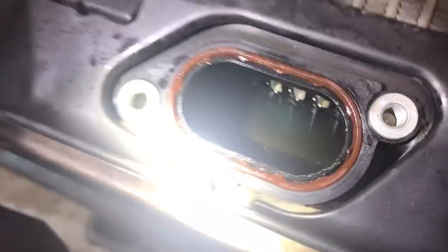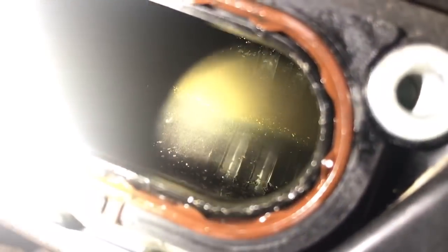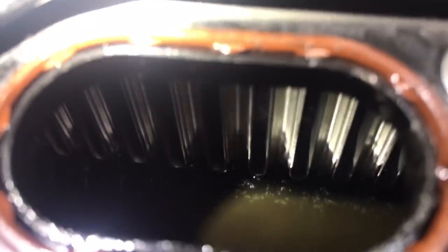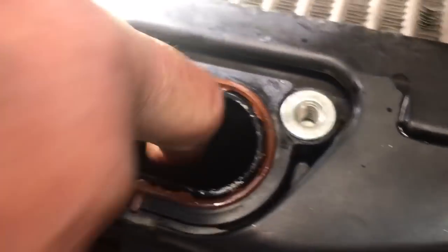I won't drain it on the bench, but that's what we're cleaning inside this pipe. Just have a look down inside here — it's very obvious because it's black. You see all that glistening stuff? It's like digging for gold, but in this situation actually digging for aluminium. What you can see there is all the little tiny aluminium particles off the compressor housing that didn't go through into the inlet manifold and are now stuck. Right down in there, all of that rubbish at the bottom is mixed in with petrol and degreaser to try and get it flushed out.